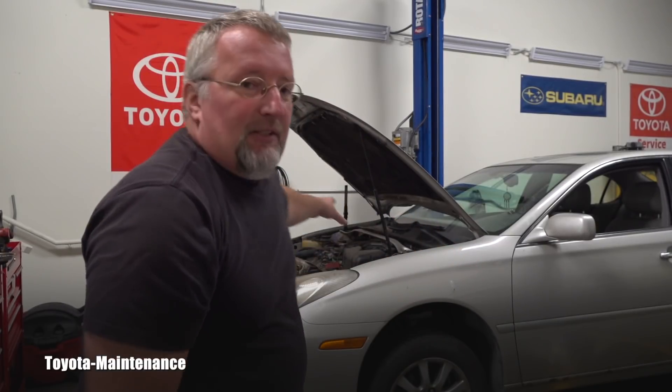It's definitely not easy. You even have to go underneath the car first — there are three supporting brackets holding that intake manifold. You need to unscrew those before you can start tearing apart the top, because there's no way to reach from the top alone. These are the little things we really need to always consider when buying a vehicle like this. I hope you find this helpful — make sure you're subscribed, I have way more coming your way soon. See you later!